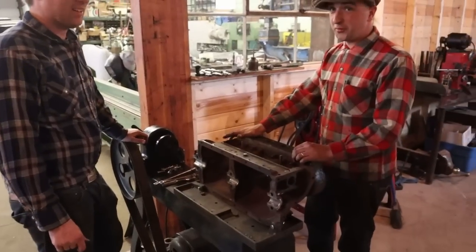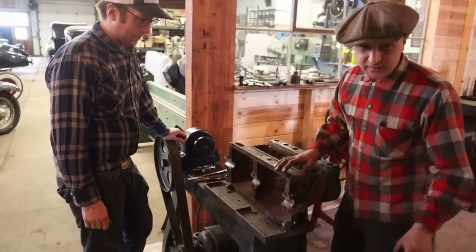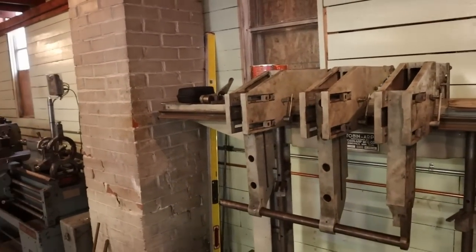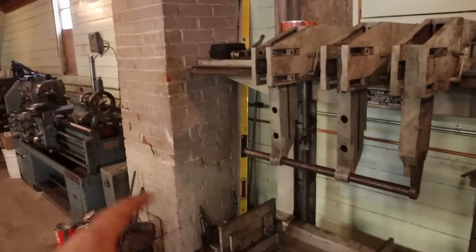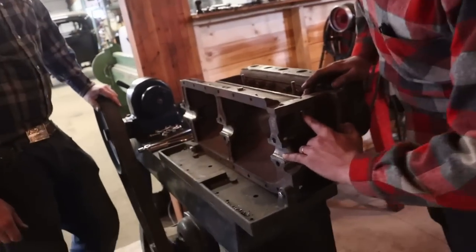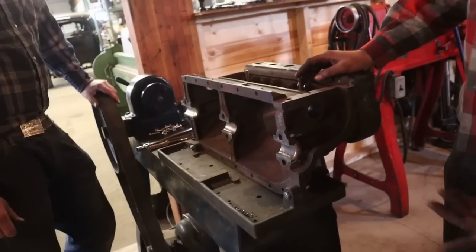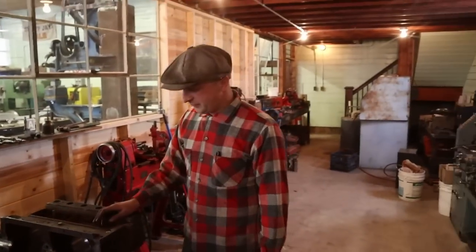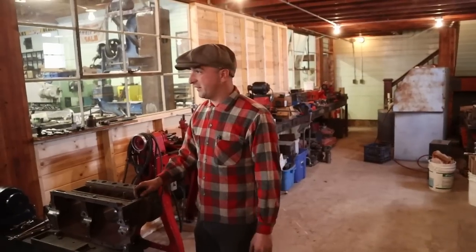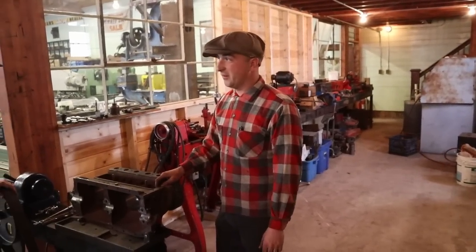In this case, it's just a giant jig. Yes. And very conventional. It is very fast, because with this line boring fixture which we have, if you're doing anything other than what we have the fixture to set it for, you have to set it all up. You gotta jig it up every time. Because this is all centered off the camshaft. Yeah, that's what this stuff is, all centered off the cam. Same as the Model A one. And you can center it off the cam on anything. We did it on Dad's other mill. Oh, for sure. But this was made so that any garageman could learn how to do this job, and you could just bang on it. And if you were doing T's in a dealership, there would be dozens of them. Or hundreds, at all times.